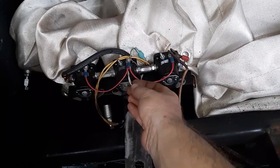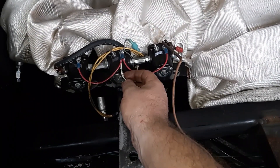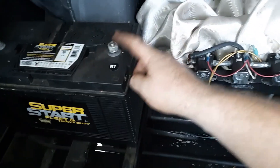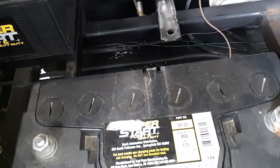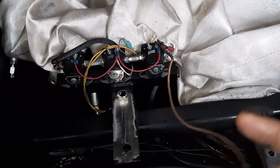You could go on the back of your switch plate or switch box and see what wires what - that's the easiest, really. But say it's mounted in the dash or in the center console and you can't really figure out what's what. Well, the easiest thing you can do is take all your power off, or at least take the power from your leading battery to your solenoids. You don't want to worry about the one going from the solenoids to the battery - you just want to disconnect your power coming in so your pump's not turning on.